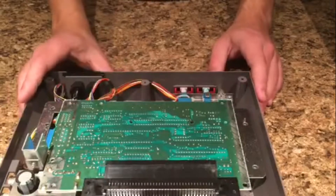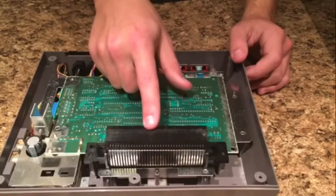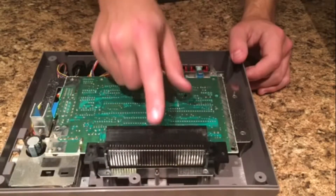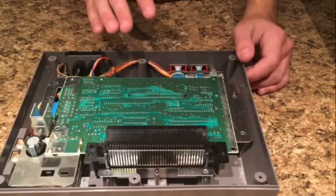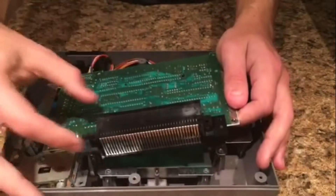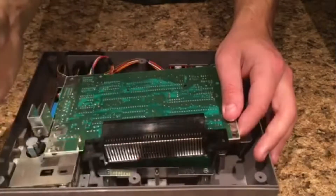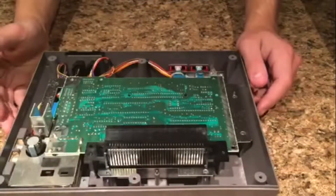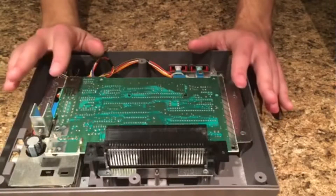So now you're down to the board — the brain of the NES. This harmonica-looking thing is the 72-pin connector. If your NES isn't working and you're doing this, this is probably the reason why, because these things suck — they break all the time and they're impossible to get working again. I'm not going to do anything with this one, but if you want to replace it, you basically just lift up the board and slide it off like taking a cartridge out of a game. It just slides off, and to get it back on you just press it back on. It sounds simpler than you'd think.